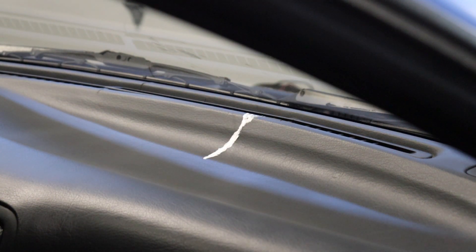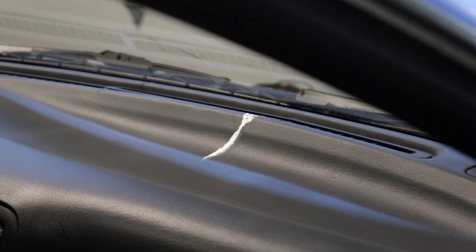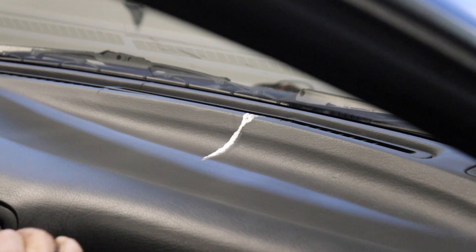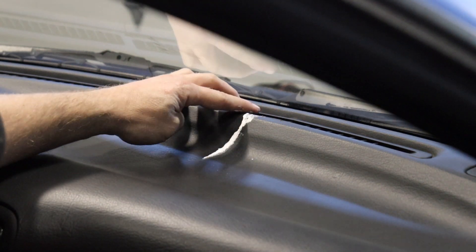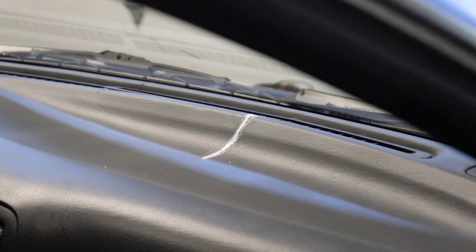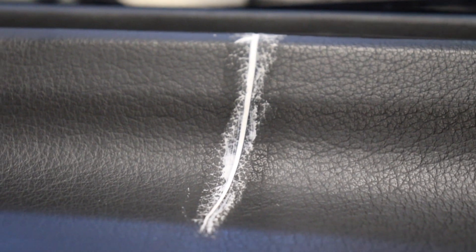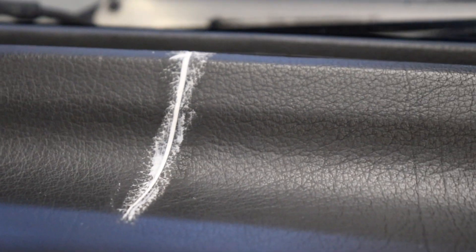Making sure to fill that crack — afterwards, after it dries, we'll go ahead and sand it down. After that, we'll try to get some paint mixed up that matches this dash. Of course it looks pretty hideous right now — basically I just put highlighter on that crack — but it'll dry. We'll paint match it; it'll come out okay. Here's a detailed shot of the crack — you can see it's all filled in with that perfect putty. We'll go ahead and let that dry, sand it down a little bit, and then color match it to the trim of the dash, same color, same sheen, and it should blend in pretty good. So far we've done a great job of highlighting that crack in the dash.